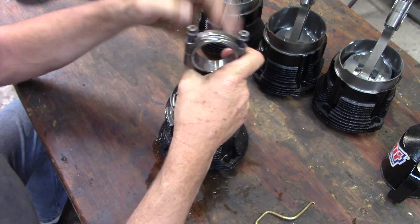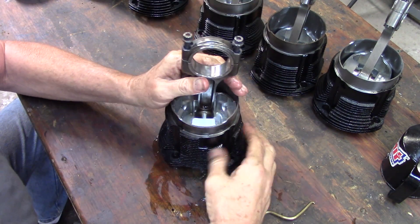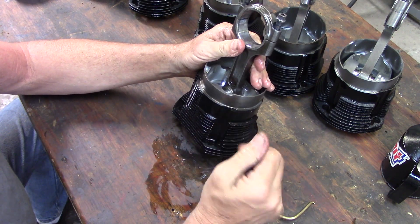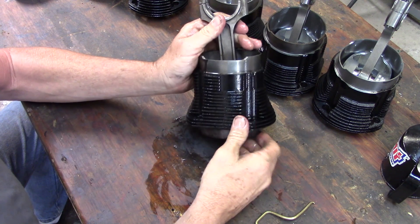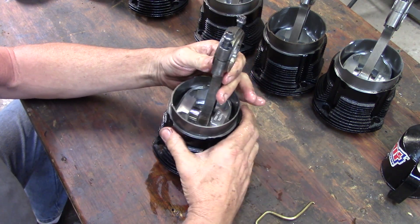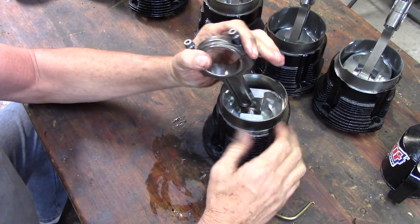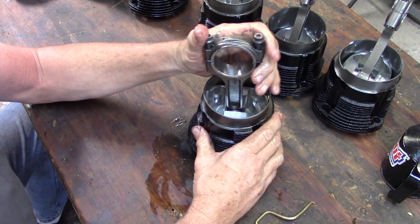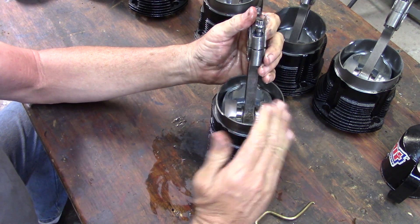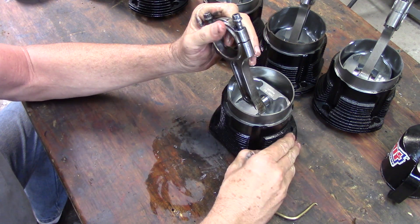And right there is how you put a piston in a bore from the bottom. This is more common on 3 liters and 3.3s that it enters that way. This is a 3 liter motor right here, and it's got an SPA 3 liter kit — a set of Ross pistons and a set of billet rods. It's actually a quickie rebuild on a motor that's got a lot of time and service. And that is how I prefer to put them together for 3 liters.